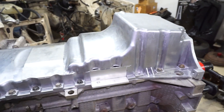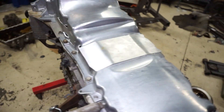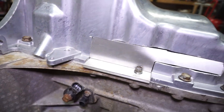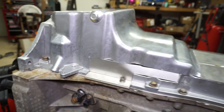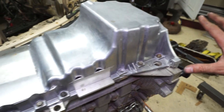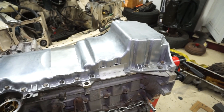All the pieces are mocked up and ready to get welded in. This piece on the back side was a little bit tricky and there are some gaps in it, but I'm just going to weld over the gaps and it should all work out. I did get this piece bolted down so that should be tight. I do have a lot of grease and dirt fingerprints on it so I'm going to brush it and wipe everything down with acetone and hope this all works out.